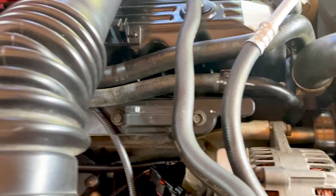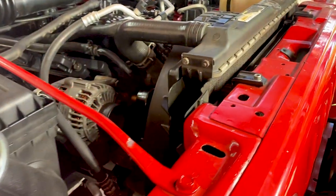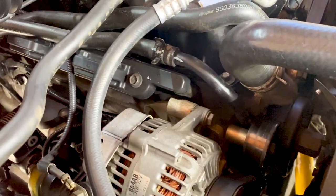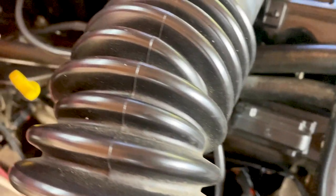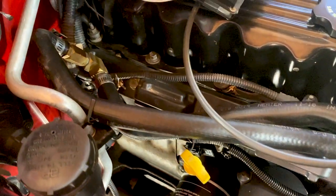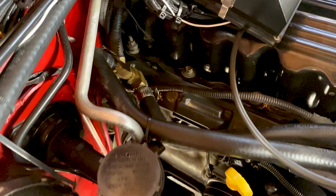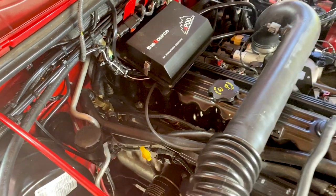The four litre six has a single rail with six individual coil packs embedded into that rail — kind of old-school but it works fine and it's never given me any problems. I'm just considering that from 2006 when it was installed to today in 2021, it's probably getting a little old in the tooth, and if we're going to start doing some long trips in this, it's one of those parts that could fall by the wayside very quickly.